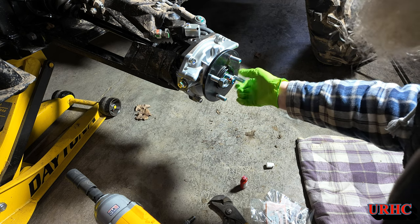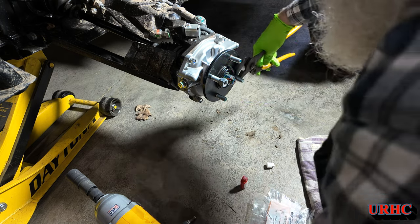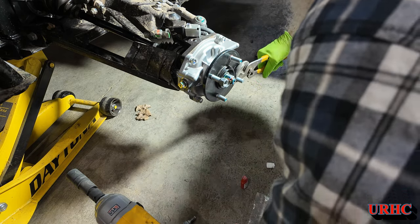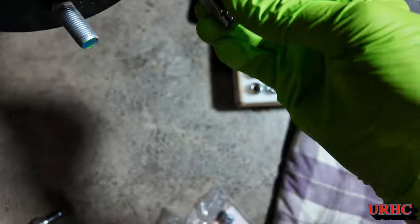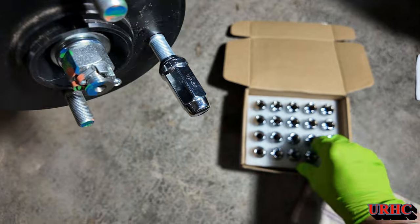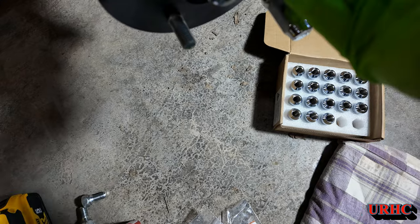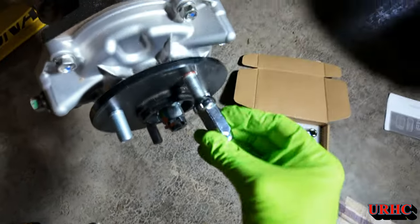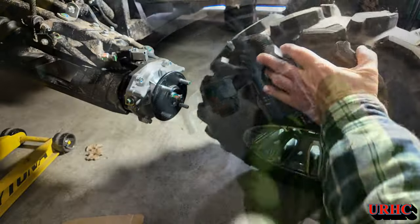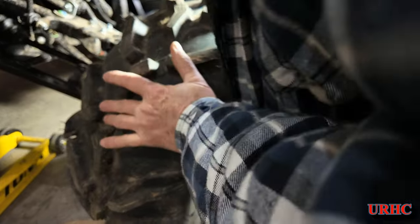There's no such thing as a stud-type half-inch-20 lug nut stock, so I picked up some lug nuts on Amazon — deep lug nuts, half-20s. They're only about $17 for the set. They look a little extra deep but the threads don't go all the way to the end, so I think they'll be good.